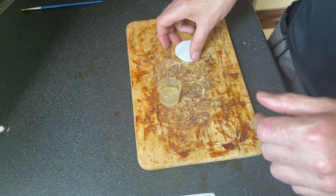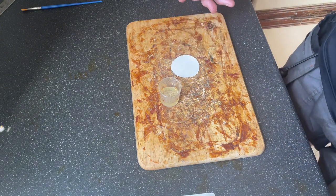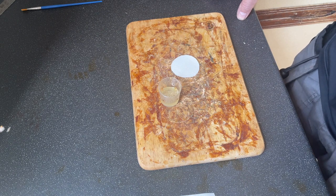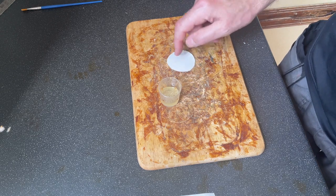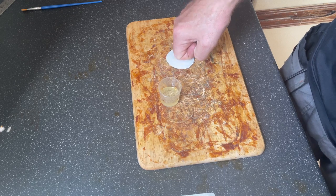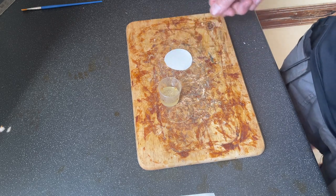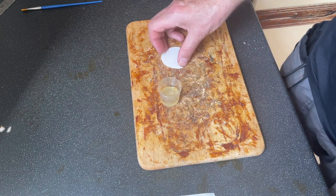Now what we're going to do is put one thin layer onto your patch, one thin layer onto your hot tub, and repeat this three to four times with two to three minutes between each layer. You just want it nice — you don't want it too tacky. Put your knuckle to it; if it's not sticking, then you can apply the next layer.